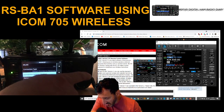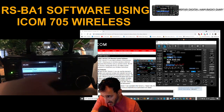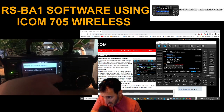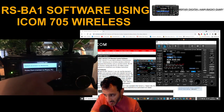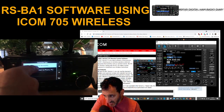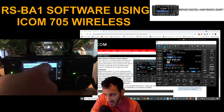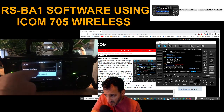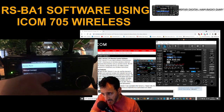If you go to Menu, Set, go to Wireless LAN, and then Connection Type — the connection type that worked for me is 'Station.' When you select Station, notice that the wireless LAN is on. You could have selected Access Point but I couldn't get that working, so I've connected it to Station to connect to the network. You choose it there, go back, and then under Connection Type Station, go to Connection Settings Station to actually set it up.